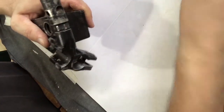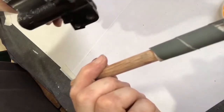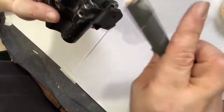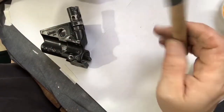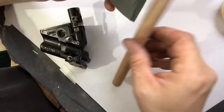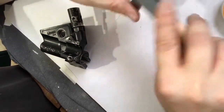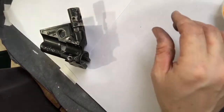Just in case, I went ahead and honed it slightly to clean it up — made my own hone, two attempts. First I tried a smaller-than-5/8ths bore dowel with two-sided mounting tape and 1500-grit sandpaper. That almost worked but seemed a little small, so I used a 5/8ths size, sanded it down, smoothed it out, and cut a groove in it. With that groove I could slot in sandpaper, add WD-40, and sand it around. I went clockwise — don't know if that matters, but that's what I did.